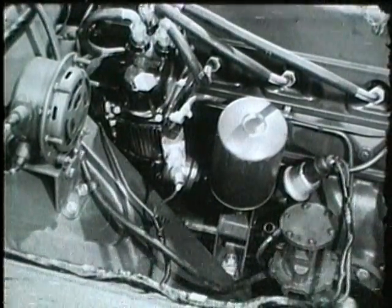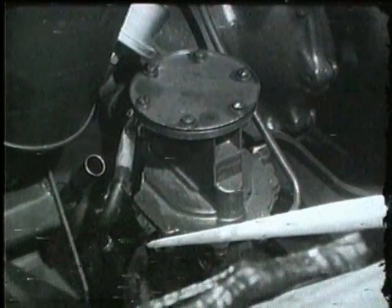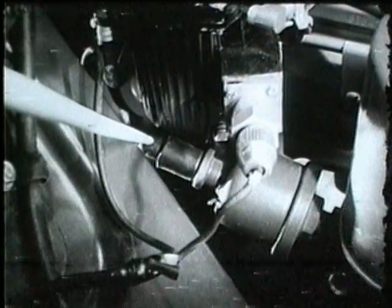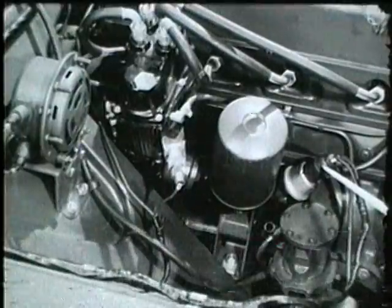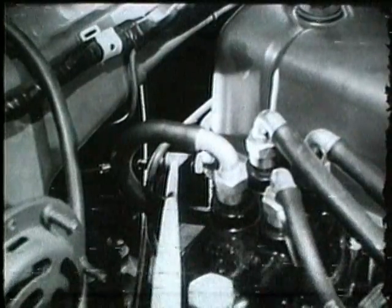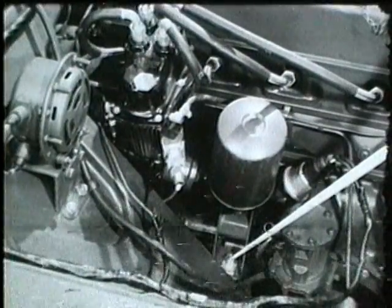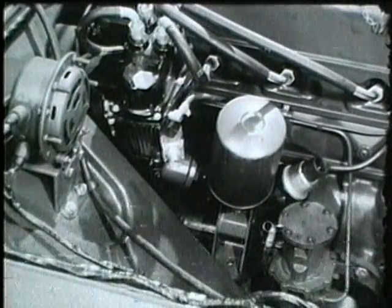At the right side of the engine, the windshield wiper hose at the vacuum pump, the ignition cable, the electrical connections to the oil pressure sending unit, the electrical connection to the oil pressure safety switch, the temperature sending unit, the ground strap, and the single bolt securing the front engine support on the right side are removed. All connections on the right side of the engine have now been released.